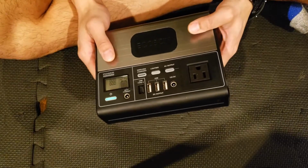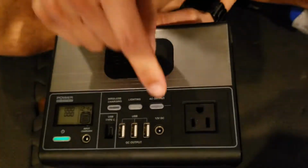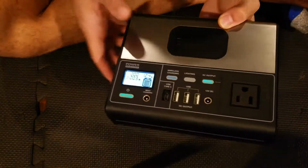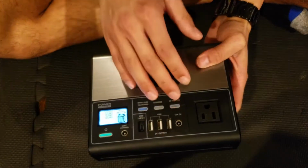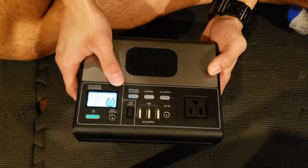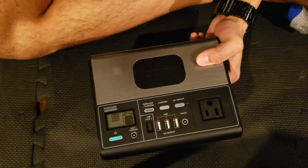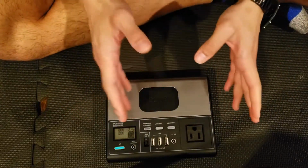product. The other thing I want to talk about, and this is the downside I mentioned with the fan that I was going to get to, is that every time you turn on the AC output, no matter what, even if there's nothing attached to it, I don't know if you can hear that, the fan comes on at a low speed. Now, maybe there's some limitation there that I'm not understanding, but I would have much preferred fan logic that only activated the fan when the temperature was above the set threshold. So under that threshold, the fan would just stay off, the unit would be silent, and only after the determined temperature was reached, then the fan comes on. And that's how most, for example, computers work and that sort of thing.